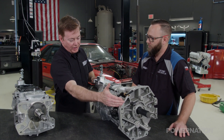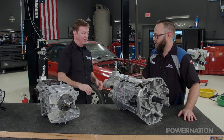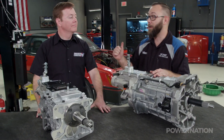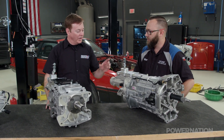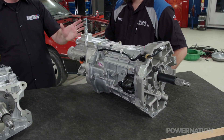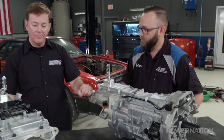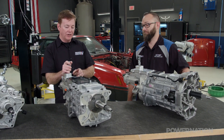So you're going to have to change the bell here. And since it's longer, completely new drive shaft, and the cross member is in a different spot. So I guess we've got it narrowed down to these two, since that T5 can't handle the amount of power we're going to be making. How do I determine which one I go with? Well, it's actually going to be a budget call. The Magnum is a fantastic transmission — great power, good smooth shifts — but it's a more expensive gearbox and you have to buy a few more parts to put it in the car. So the TKO will save you about $1,100 and do everything you need it to.